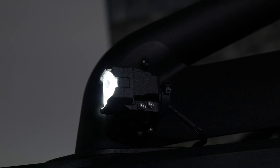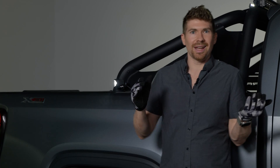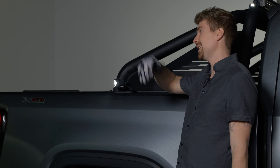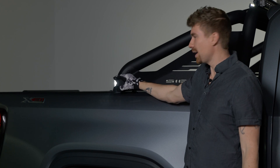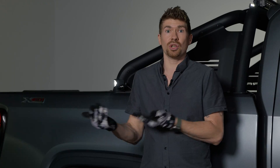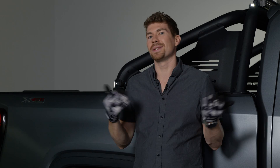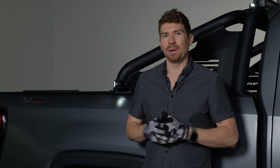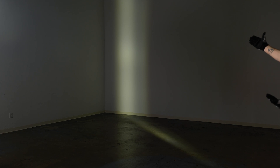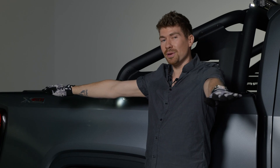This right here — the one banger in a wide beam pattern — is mounted to this headache rack. I know a lot of you guys are saying that looks stupid, but yes, you can mount this on the inside. It's the whole point of an Omni bracket — you can put this anywhere. This can easily be mounted incorrectly. If you just use a regular U bracket that the original one banger would come with, it would look something like this on the wall, and obviously that's not usable. Having it sideways might work for your spot, combo, or flood beam pattern, but if you're going to use a wide beam pattern because you want the most light output as far out there as possible, then I would definitely recommend the Omni brackets and make sure you adjust it just right before you tighten everything down.